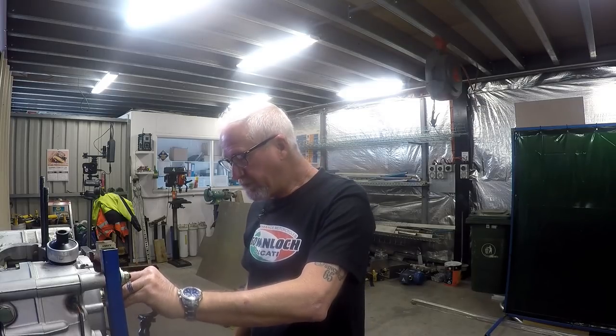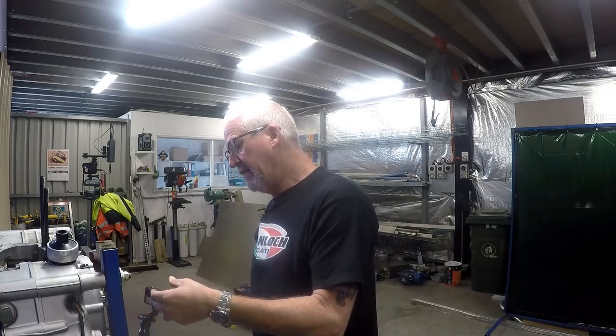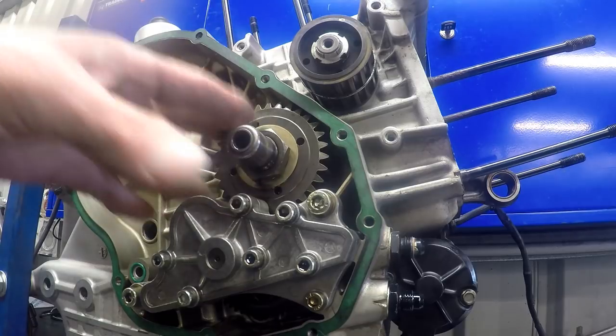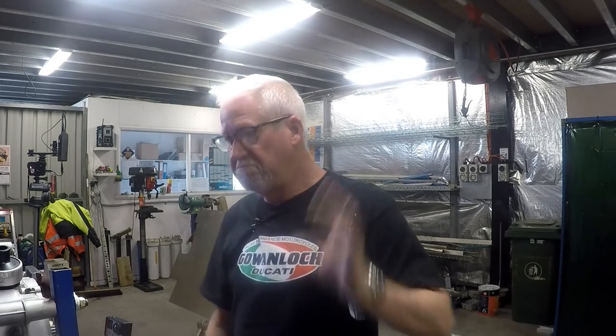Best I can figure out, I need to pretty well pull everything off both sides of the engine. I'm going to take the oil pump off, the primary gear, the belt drive stuff on this side, flip it around, then pull out the starter motor and the gear selector assembly and everything else. Let's stop waffling and start unbolting.